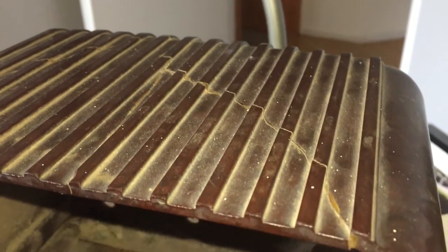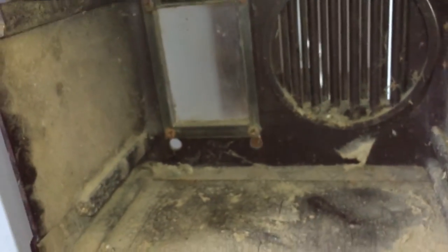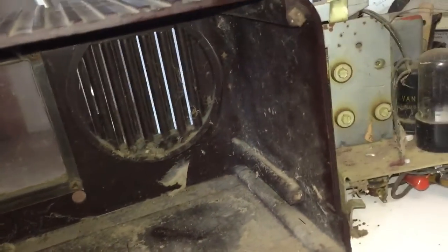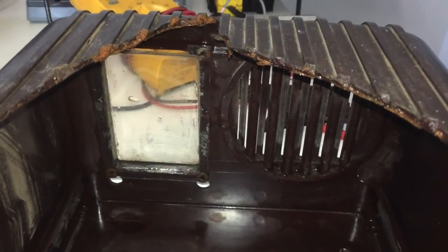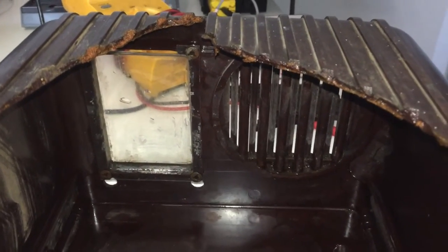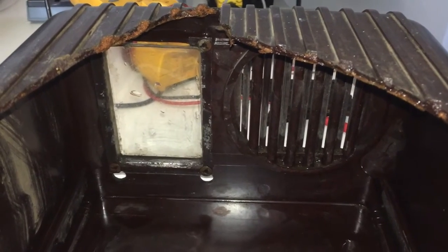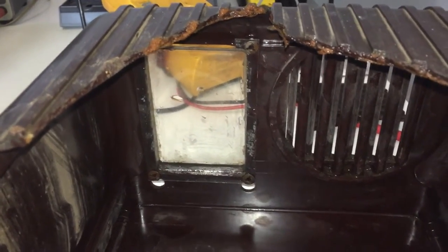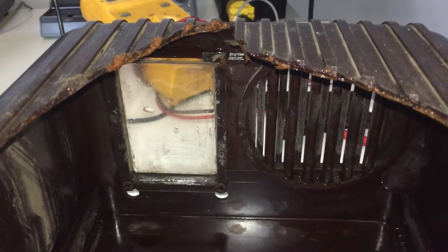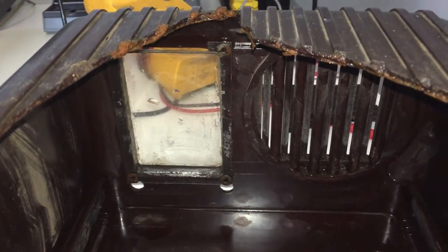We'll see what could be repaired. There's a lot of dirt — let's just wash this off. This is terrible. I was able to get the radio cleaned out and all of the dirt removed. Luckily, the repair job was so bad that when I added hot water, I was able to get the seams to swell and separate the glue from the bakelite, so I was able to remove all of the repair work and take it out of the radio. I have it stacked up behind the radio right now.